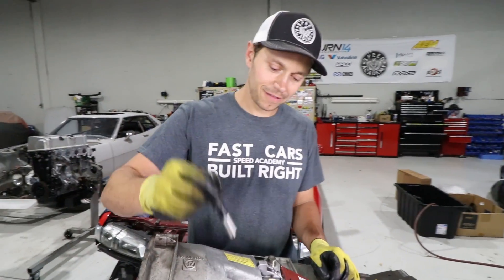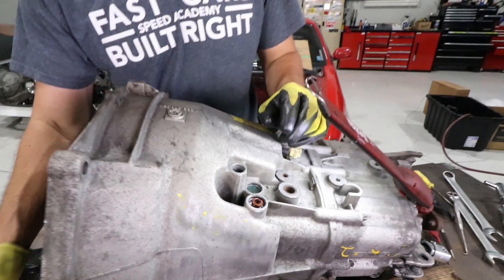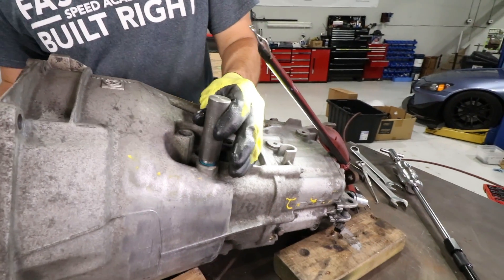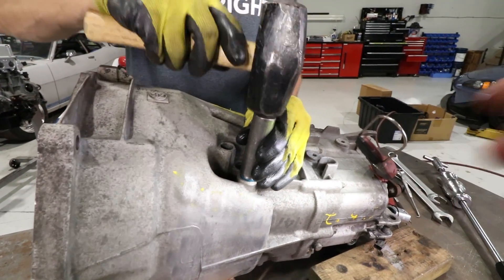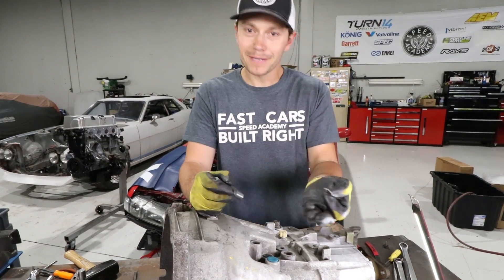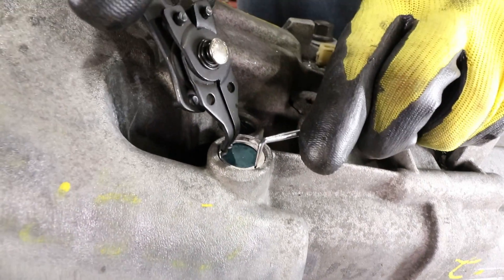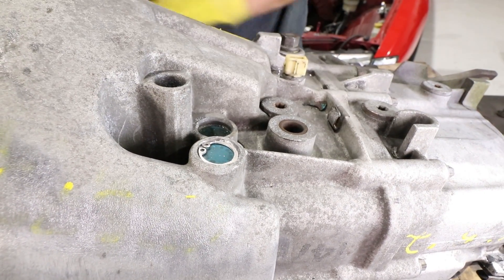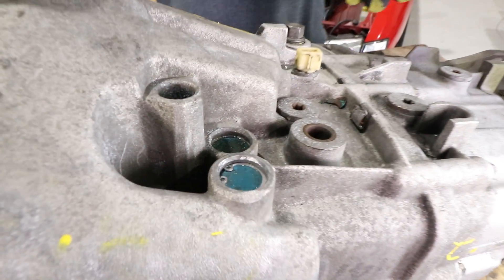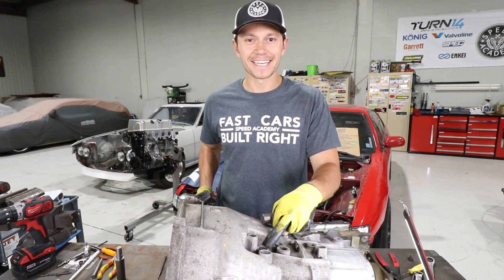Let's test the new shift pin and see if it just glides in there. That is nice. Now we just drop the pin back in - we've got a brand new cover that goes on there. The cap kept popping up because there's a spring behind it. I figured out a technique: get the c-clip down into the area somewhat and then hammer it, which seats the whole setup. Like a boss. Now it's time to do fifth gear all over again - total victory.